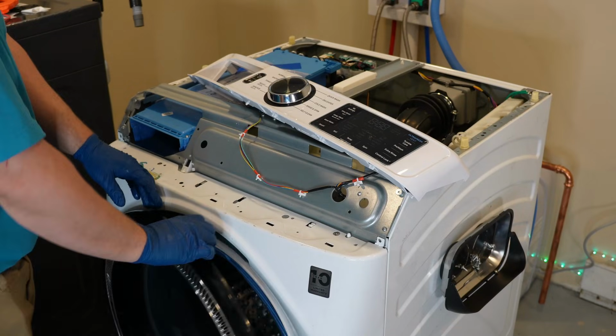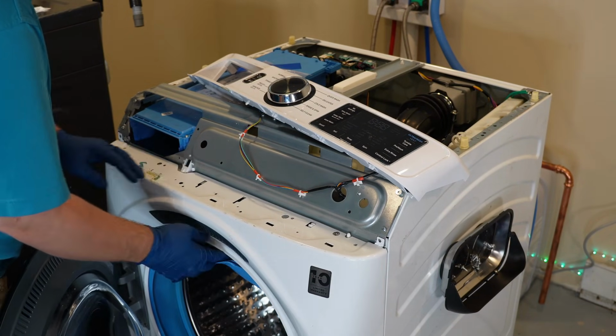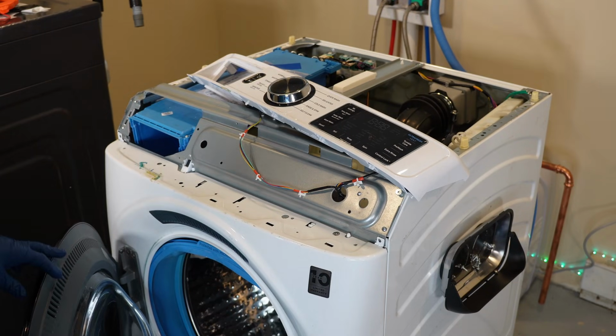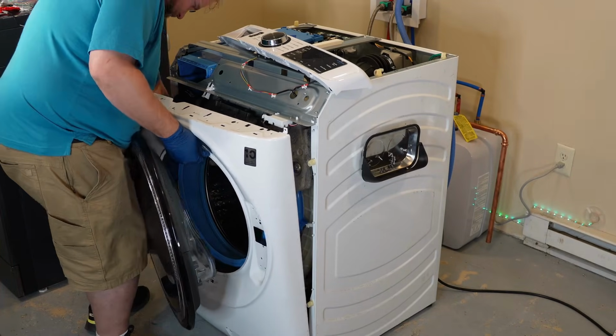The 3 middle ones deal with the damper fan, so when you have those removed, you can slide the fan to the rear and uncouple it from the bulkhead using the inside where we had removed the gasket. You can then lift up and forward on the bulkhead to begin the removal process.